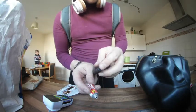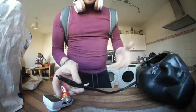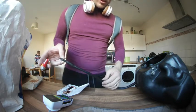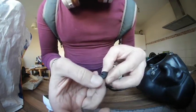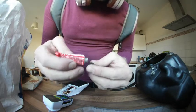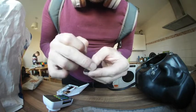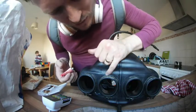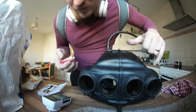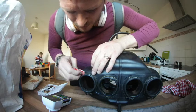This tube is to collect all the petrol if it shoots out from the carbs — obviously then instead of leaking on the floor and potentially catching fire, it just catches up there and stores it. That's why I found a lot of really old petrol in there while I cleaned it. I managed to clean it, but there's a little hole in there that's not supposed to be there. So I'm going to use Elastic Fantastic glue, which is basically a very rubbery glue. That should seal it and it does hold really well. I can see there's also glue holding these rubbers inside the plastic from the factory, and some of that glue is quite dried out, so I'll apply just the same Elastic Fantastic and make sure it's all properly sealed.